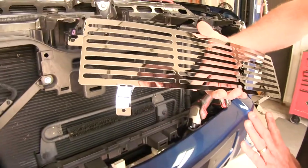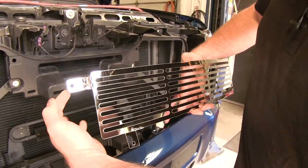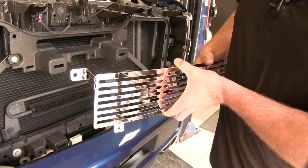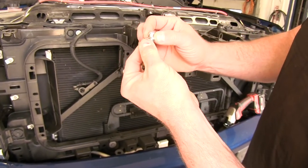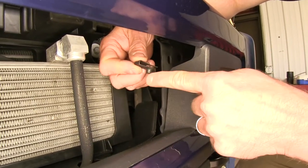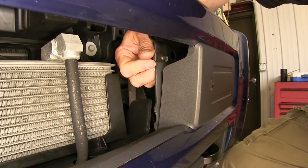The grill insert has two tabs on the bottom and two tabs on the outside. The screws we just removed from the bottom of the bumper opening are going to go through these two bottom tabs. If your vehicle is equipped with bolts on the top side, you would remove those as well. Our vehicle does not have them, so the kit comes with clip-on nuts, a quarter inch bolt, and a lock washer. The nut clips over the side of the bumper bracket with the threaded end protruding out — make sure it points toward the front of the vehicle since we'll put the bolt in from the back side. Line it up over the hole and do the same on the other side.